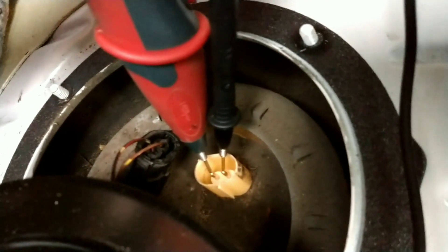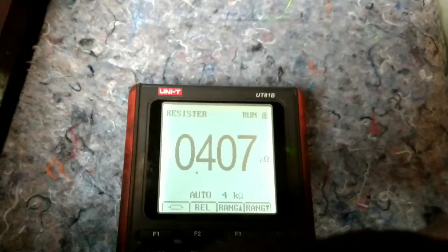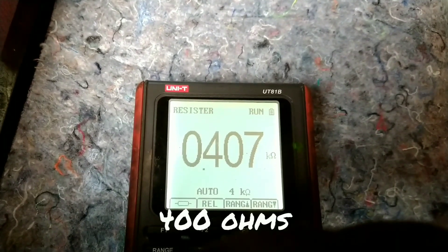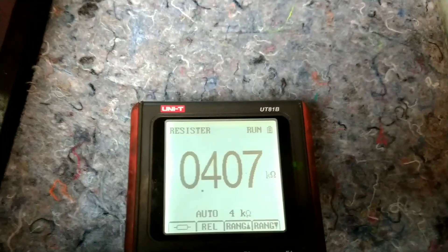These Load Pro leads make it easy to go on the top of the pins without them slipping off. I think the other side — the left-hand side — was 50 ohms. And this side's reading 400 kilo-ohms... actually, it's about 100 kilo-ohms. No — 0.4, so 400 ohms. I almost misread that.